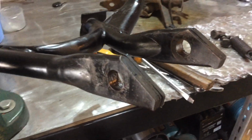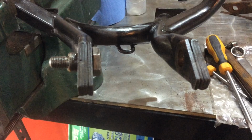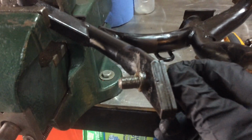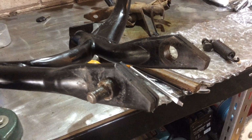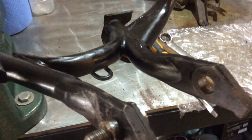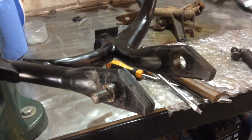Right, so the mounting bolts, they are shouldered, and they go through from the inside like so, and then they also shoulder on the frame, on the bracket on the frame on the bike. So these are a really good slip fit, which means there's really no wiggle room. You've got probably a couple of 100 microns of clearance. So if you try and put the stand on the bike by connecting the spring first, you are going to be pulling against a very taut spring to try and get that aligned, and that's incredibly difficult.